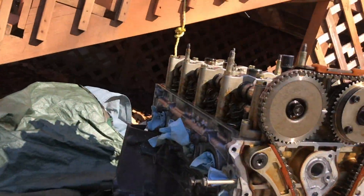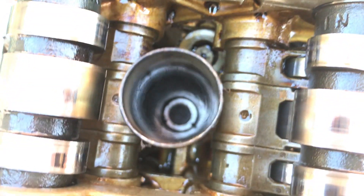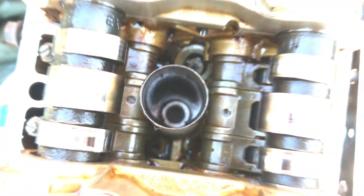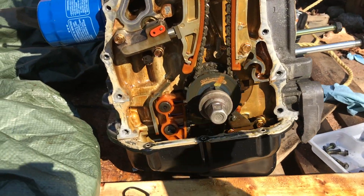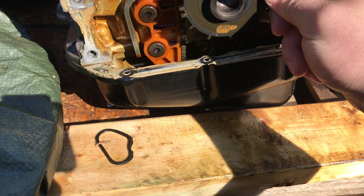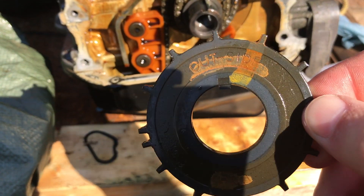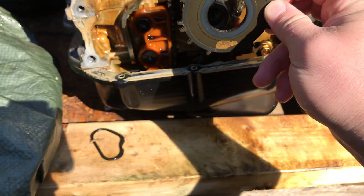The piston is all the way at the top right now. Let's remove this crank bolt right here, this key piece — this gear slides right out. Make sure that when you put it back in, the outside faces towards the outside of the motor, so towards you. Now you can see the bottom crank mark is aligned and the punch marks are horizontal from each other.